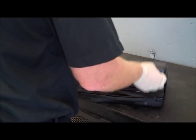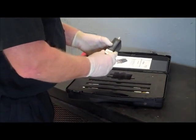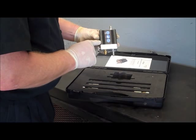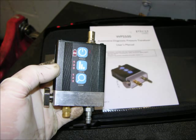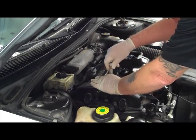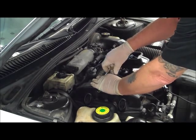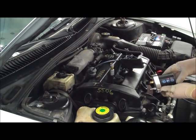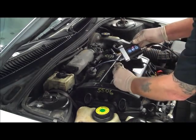The last technique I'm going to show you uses a pressure transducer like this WPS 500 from Pico. Fluke and Automotive Test Solutions also make pressure transducers. This tool actually measures the pressure in the cylinder and can also be used for nearly any pressure measurement you may want to perform, including fuel pressure and other hydraulic measurements. The WPS 500 has three pressure ranges and three zoom levels, with a rechargeable battery, and comes with the adapters you need to connect to most engines. The tool is used in place of the spark plug and can be used just as you would your mechanical compression tester. The advantage is that you can trace the pressure throughout the entire 720-degree piston cycle, gaining lots more information in the same amount of time.